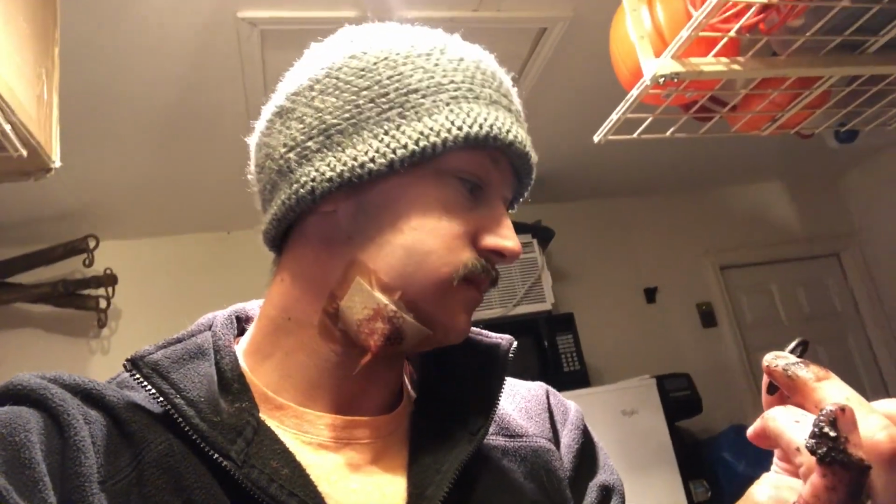So I'm gonna remove all these tonight, then I'm gonna leave this thing sitting overnight. Tomorrow we're gonna just flush the heck out of this block. It should cool so much better after this. Like, I don't even know what this is. It's not rust. I thought it'd be like built up rusty sand, but it's not metal. It's like dirt. I don't know. Anyways, pop these freeze plugs out and see you mañana.